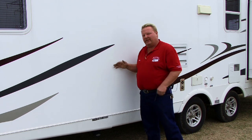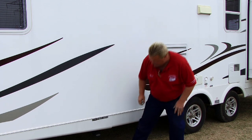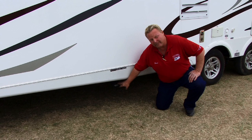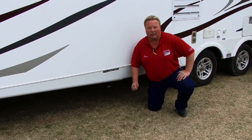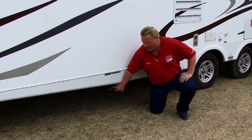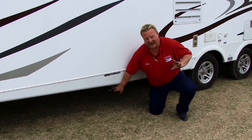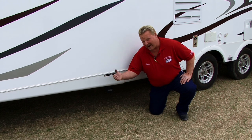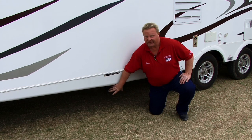These lines are connected up underneath the home and there's usually two valves, one for black water and one for gray water. As you can see here, this is the cap and this cap normally will have a hose hooked to it that will go to a sewer line at an RV park or wherever the customers park. When a customer's unit is telling them it's full — they usually have a diagnostic board in these things — they'll come out here and there's a valve handle.